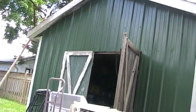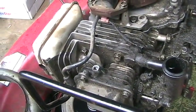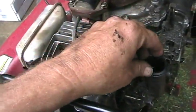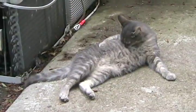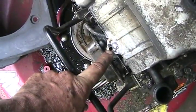Back to business. Before you put the cover back on, you've got to make sure you get all of this debris cleaned off so your motor can run effectively cool — so you don't cook your engine, fry your rings, and so on. Use a pressure washer — but if you do that, cover up the carburetor — or compressed air, or a brush and solvent, whatever works. Now final assembly. The mounting tabs were broken off this heat shield, so I just welded washers on. Now we're ready to put the plastics back on.